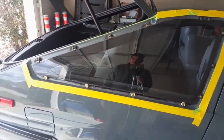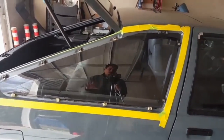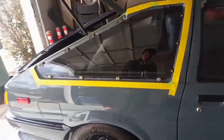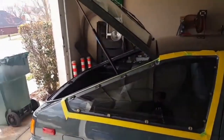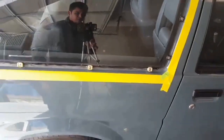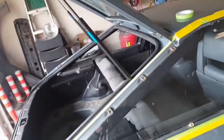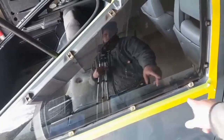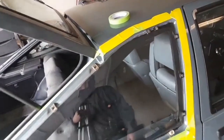All right, we're going to do the trim for the rear quarter panel windows. As you can see I've got it masked off a little bit — you don't want to scratch the paint with this trim as it's got some sharp edges on it and it can get a little crazy sometimes. So just put some masking tape around the perimeter. I'm actually going to put another strip down here along the bottom. Now if you're like me and you had your rear quarter windows sealed, go ahead and look to make sure the clips are back in the right place beforehand.